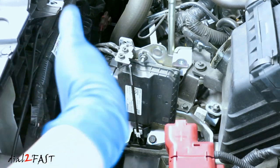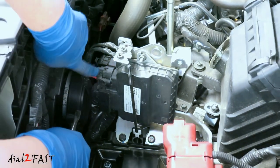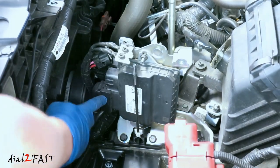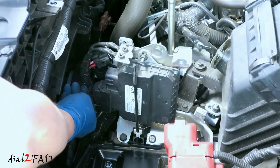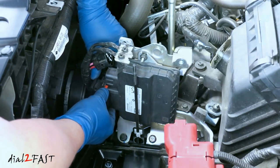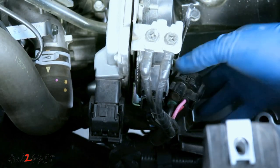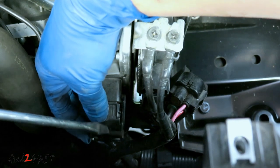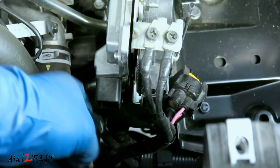To give you enough room to slide the cooling fan assembly out, you will have to disconnect the two connectors on the TCM and the one connector on the VTC module. For the first connector, push down on the tab and slide it out. For the second connector, there's a latch at the bottom — push down on the middle section at the bottom and that will allow you to lift the handle and slide it up. Slide the latch all the way up and the connector will come out. The right side are the connectors I removed; for the remaining one on the left, push the plastic tab in the middle and the latch will go up — slide it all the way up and this connector will come out.